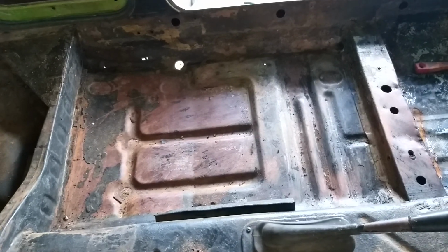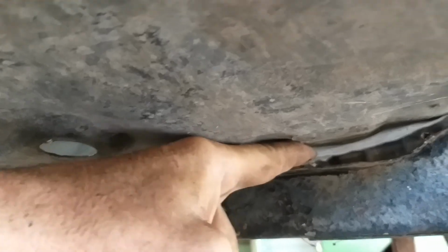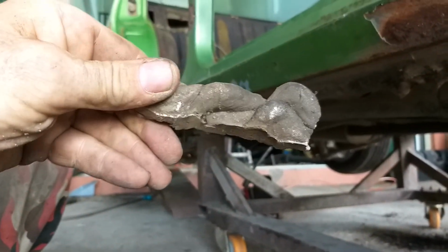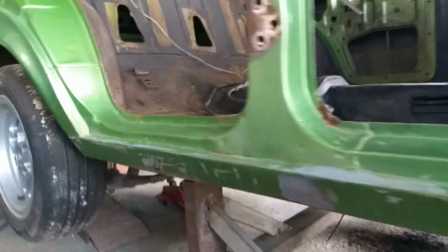Unfortunately, the worst part about it is the repairs that have been done before. The front floor pans, they're absolutely shocking. What they did was they went the floor pans in and didn't bother welding them to the chassis rails, which are here. Get my finger right through there. Tidy. Mind you, what they did do was fill all those gaps up with filler. Make it nice and strong, eh? So now, I've got to put all that right.